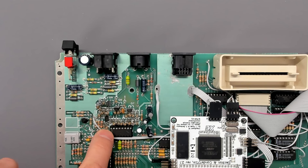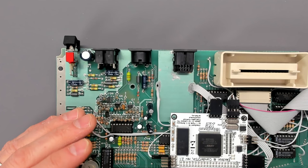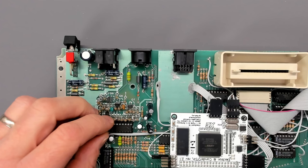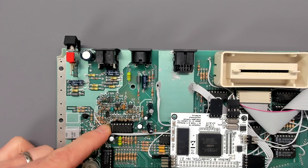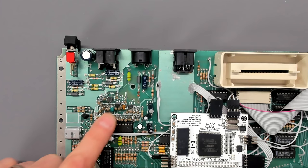It's almost certainly not going to be necessary — it's almost never necessary on the 600XL, which has among the nicest video out of the box you'll see on an Atari 8-bit computer. One thing you need to do is remove the capacitor at the top left corner of that CD4050 chip, because it's a blurring cap — it blurs the image. It was probably put there to minimize any graininess or jail-bar effect, but there generally isn't any such thing on the 600XL signal anyway, so I always take that cap off when I have a 600XL through my hands.